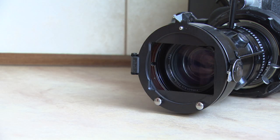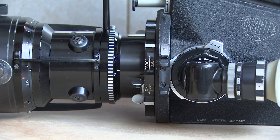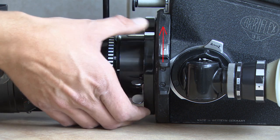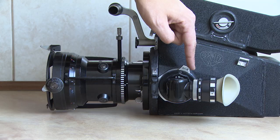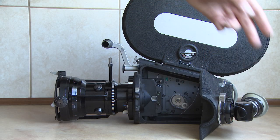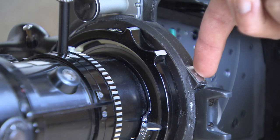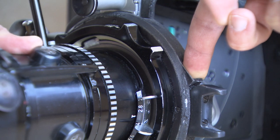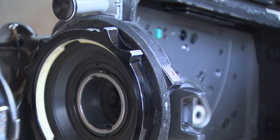If your second lens already has the filter basket mounted, you can skip this step. Turn the lens mounting ring in the direction shown by the arrow and open the camera door. Then press and hold down the silver button, twist the lens counterclockwise, and gently pull it out.